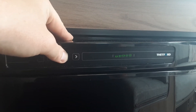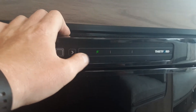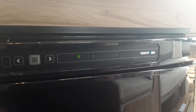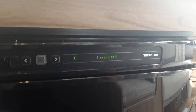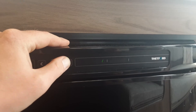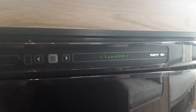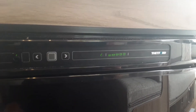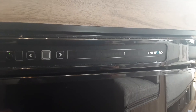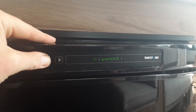If you want the beers nice and cold, I advise you to have it on the coldest setting. Press the button again and we'll go across to 12 volt. 12 volt is the power source from the car you are towing with, not the 12 volt battery on board the caravan — essentially, as long as you've got the right plug on the back of your car, the fridge will work as a cool box. The temperature control in cool box mode is completely irrelevant. For gas, press for it to ignite on gas and press the button again for the temperature. The gas system will self-ignite as long as the gas is turned on. If it ever failed to ignite, it would flash the pilot light and also make a bleeping noise to let you know it had failed.